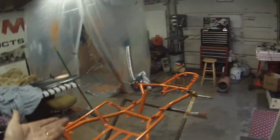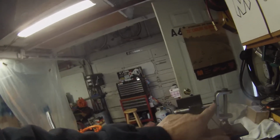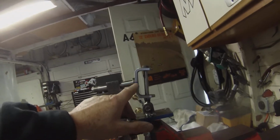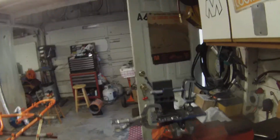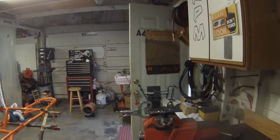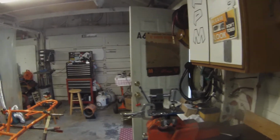Now, this car is really offset, but that's how we drove it. It drove fine, so we're more than likely going to get it on the scales and tune that front corner down. We're not going to change where this stub axle is located centrally here. It's just a little above center, and that's how they were on the old spindle. So we'll do that, and with the extra tunability we have with the ride height adjustability of this compared to the old one, we'll be able to fix it up.